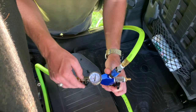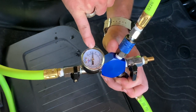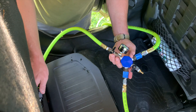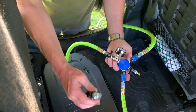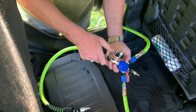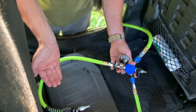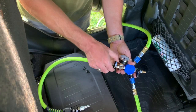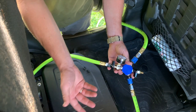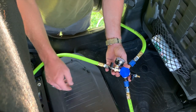Now that your tires are all connected, it's time to deflate. Right now you have positive pressure between 20 and 40 PSI — about 30. To deflate, you don't connect to the compressor. You leave the open orifice hanging outside the vehicle or wherever. Open up the valve — the same valve you'd open to inflate, but without connecting to the compressor. You do that for an amount of time. In my case it was about 5 minutes to deflate all four 37s.